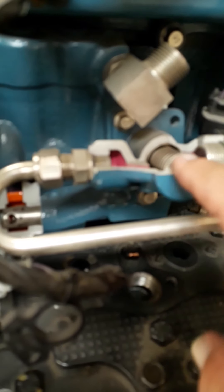The fuel goes around to our lift pump, which is a plunger type bolted to the high-pressure oil pump to operate it, but fuel and oil are kept separate. There's a little cam plunger pumping the fuel out into the top part of the fuel filter, which is where the filter element is — that's where our fuel filtering happens. The top and bottom of this filter are separate; the bottom is more just a water drain and separator.